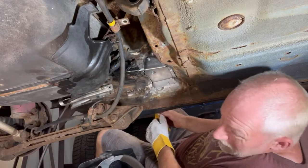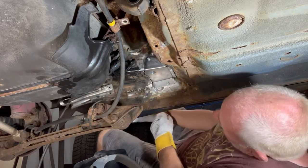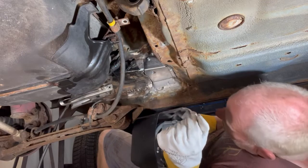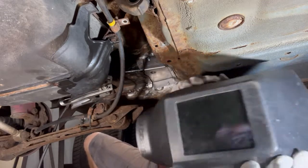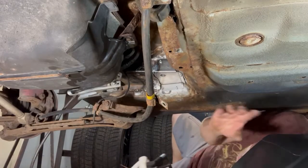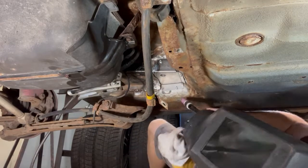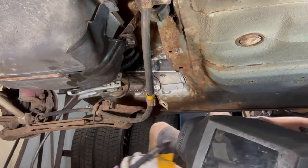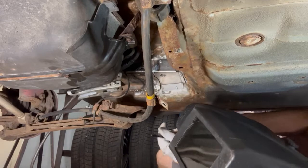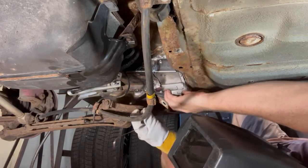Patch panel's all in and ready to go. Welder hooked up, ground on — let's see how this goes. I'll get it tacked into place and remove the screws. The space is tight; I don't have a lot of room. Tacking this thing has been a bear — trying to keep my helmet on, get my foot on the pedal, and the torch in my hand has been a real challenge underneath here. I probably should have jacked the car up another five or six inches to give myself more room, but we'll struggle through it.